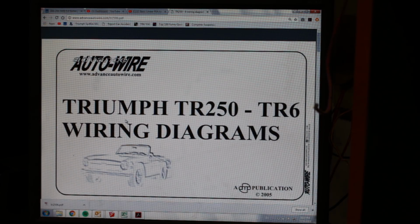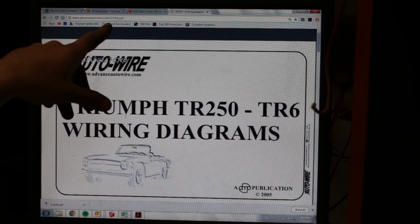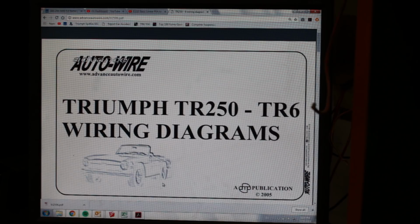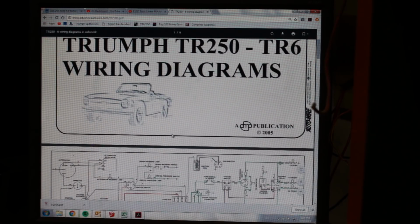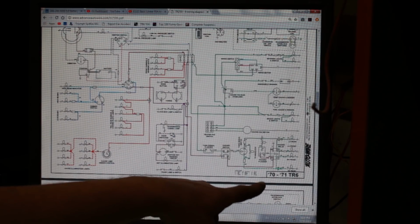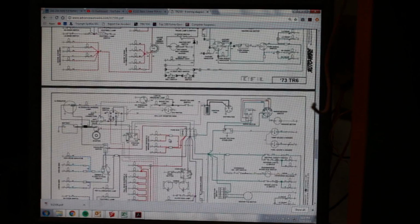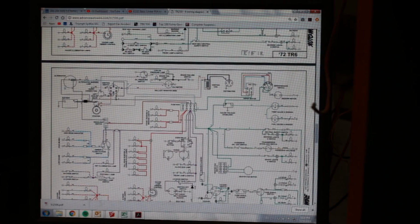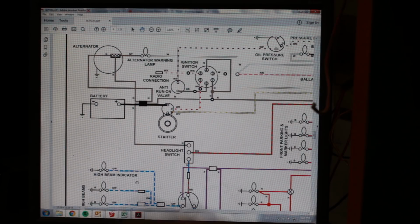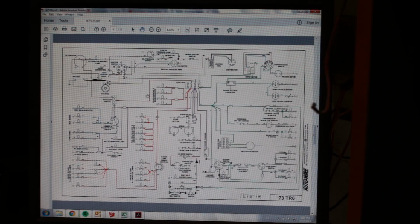So online, I found this website. I'm gonna put the link in the description, but I'm also gonna tell you: www.advanceautowire.com/TR2506, that's for TR250 and for TR6 PDF. And here you can find the wiring diagrams for TR250, for TR6 from 69, 70, 71, 72 and 73, etc. So this is the one that I need, the one at 73, and I even managed to download that, and here it is. I have it on my screen now, and it is with colors, and you can see the wiring colors, and it's much easier to work off this.